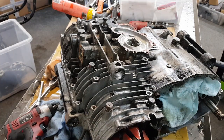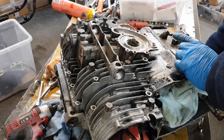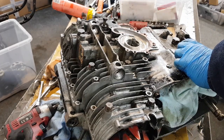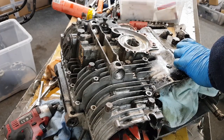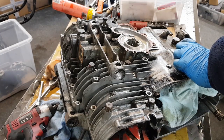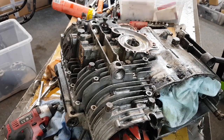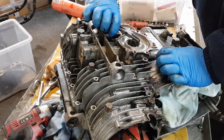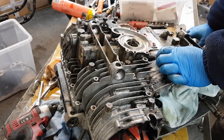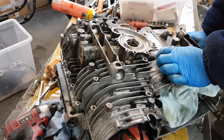And if you've got carpet in your garage, get it off the carpet quickly. I've seen people trying to get those off and smash the impeller. All you've got to do is heat it up, and the correct pair of circlip pliers. Remove circlip. There we go. And once the impeller cools down, that will go in with the two circlips into a seal bag. So we're sorted.